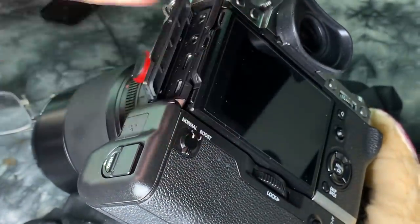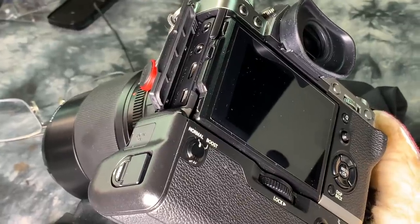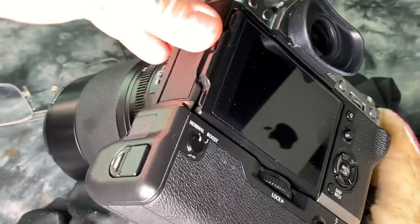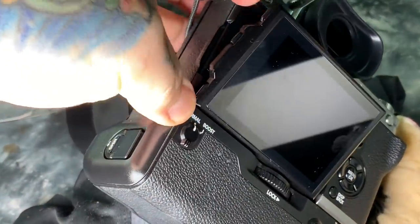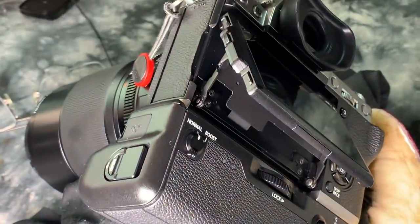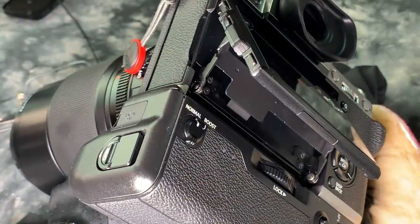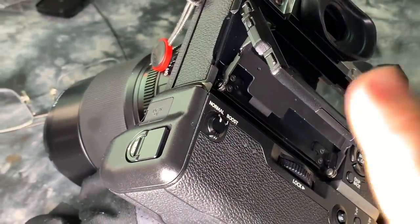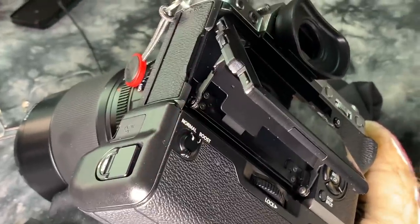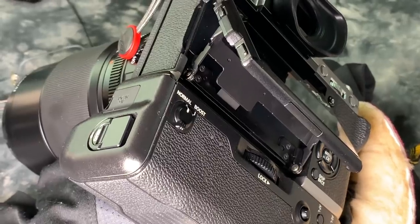To get a camera flat like this — Sony does the same thing, and so does Nikon — this nice flat display that snugs up against the camera so the entire profile of the LCD is quite small creates a design problem. The only way you can make this LCD super flat is if you use this paper-thin fragile flexi cable that feeds power and information from the main board to the LCD.